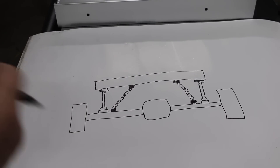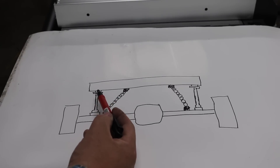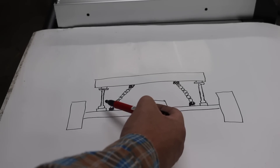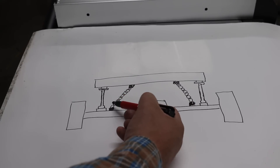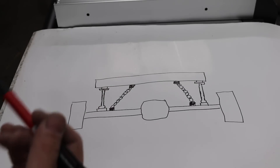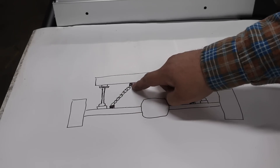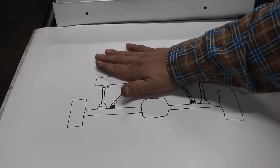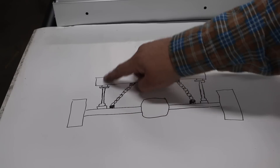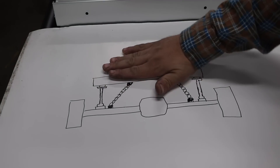So in my detailed illustration here, you can see when this cylinder gets up high enough, this chain gets tight. This chain doesn't do anything. Whatever side you're trying to three-wheel, that's the chain you really need to worry about. So when this gets tight at this point, that cylinder's raised to that point and your chain's tight — you can actually hear and feel it. When this cylinder goes up any further from when the chain's tight, it makes that frame pivot right there, pushes this part of the frame up higher, which makes your front wheel hopefully lift off the ground if you have enough stroke. And it also pushes this side of the frame down to the ground.